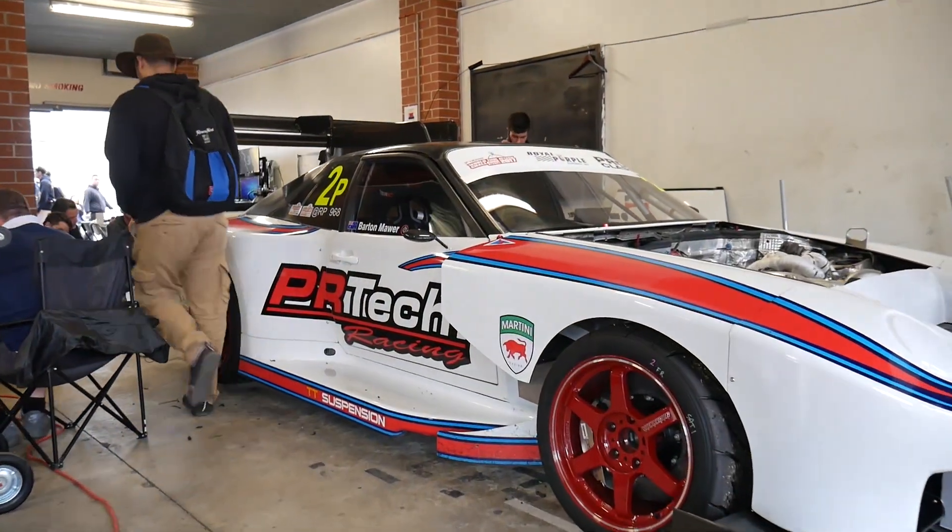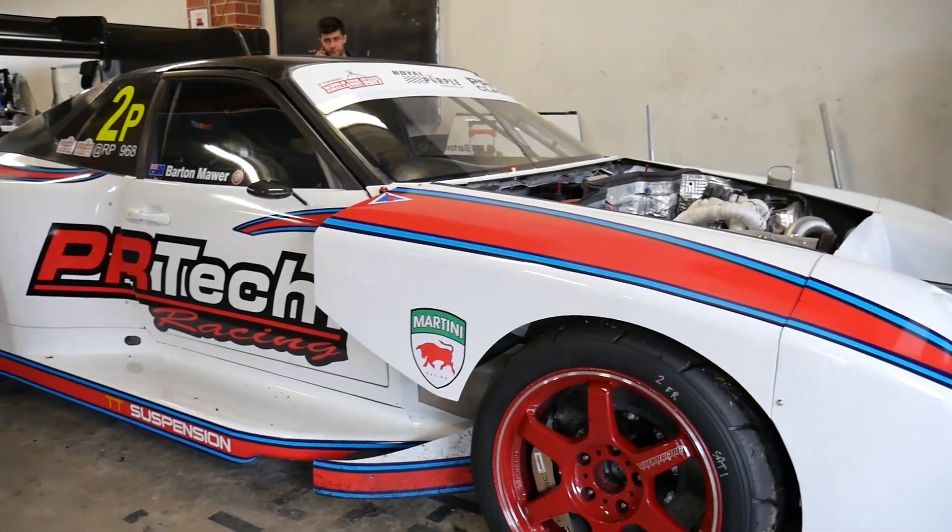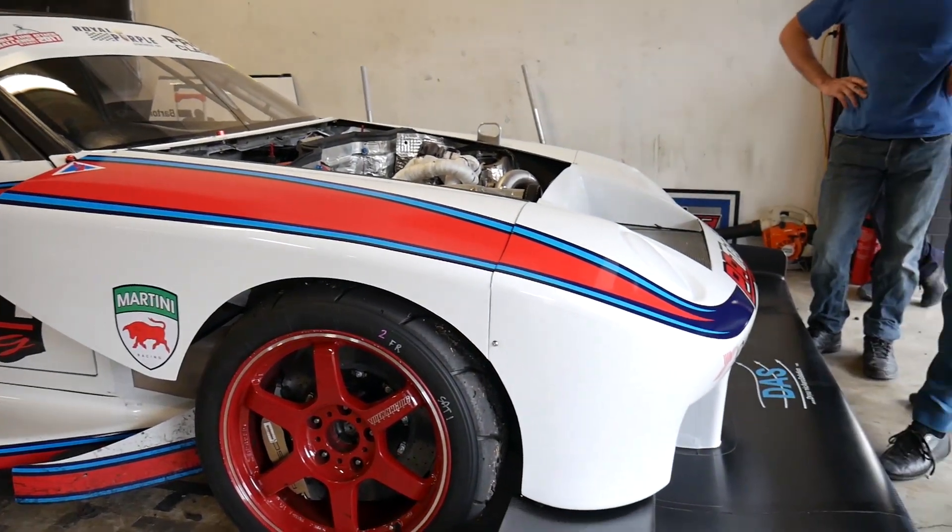On the RP968, are you mapping this to track position, driver input, or ride height? Our inputs on the RP968 are ride height via damper potentiometers, lateral G's, longitudinal G's, roll rate, and pitch rate. We also have five user settings — five modes that we can operate — and we can use the MoTeC dash to switch those modes as a function of any other variables, which might be lap distance, speed, position on the track, etc.